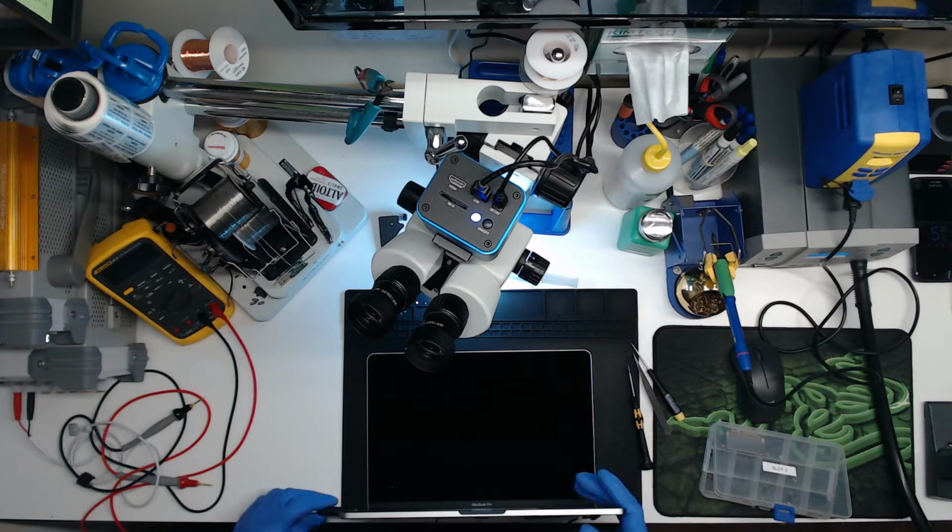You watch the screen for me and I'll watch the board. Yep, so it's 20 volts, 500 milliamps. So we should get a blinking question mark folder. So we'll just plug in. Yep, there's a chime sound saying, hey, you plugged something into me.